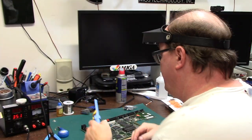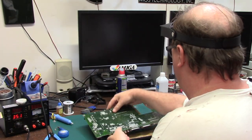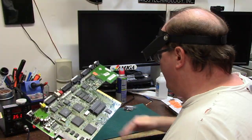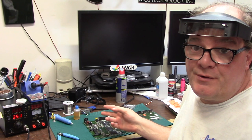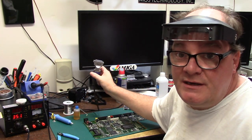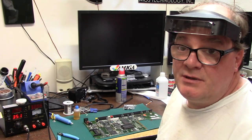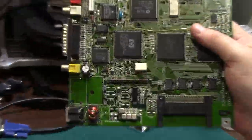RF modulator is out. For the RF modulator I use the old school solder sucker because it's got a big snout and pulls a lot more volume in, especially for something that large. We'll clean up the holes with some braid. Our holes on the modulator side are clean and that can be used for an HDMI port or a VGA port for your Scan Plus or whatever you've got. They also draw a lot of current, putting a little strain on your old power supply. We don't use them anymore with modern solutions like the simple DB23 to VGA or an AGA Scan Plus, etc.